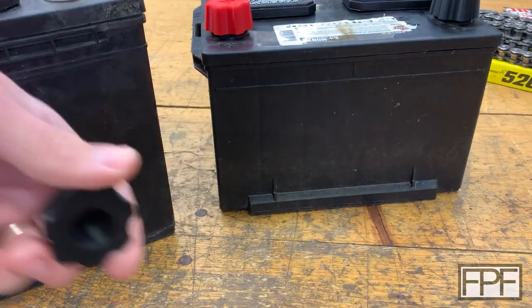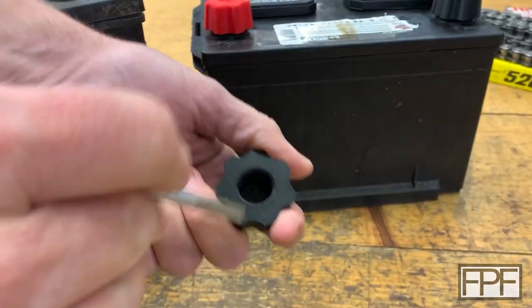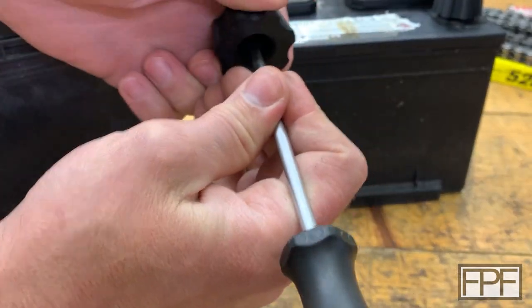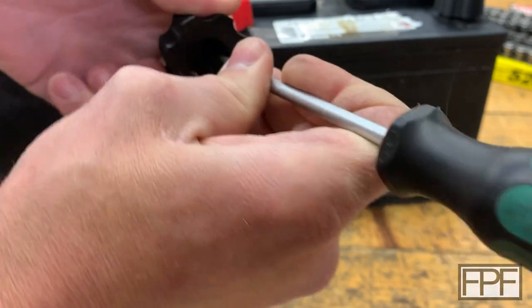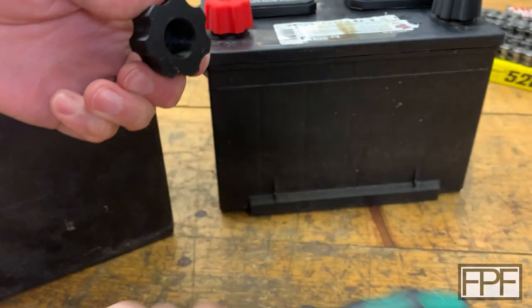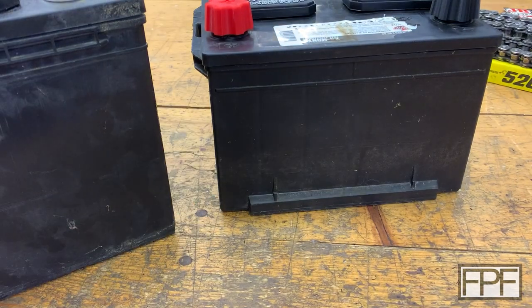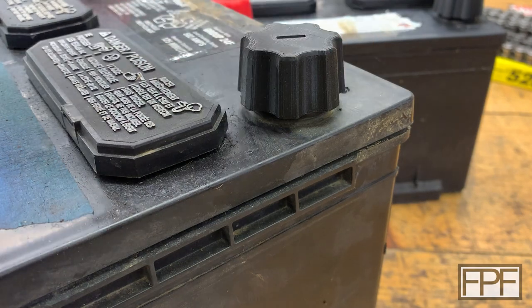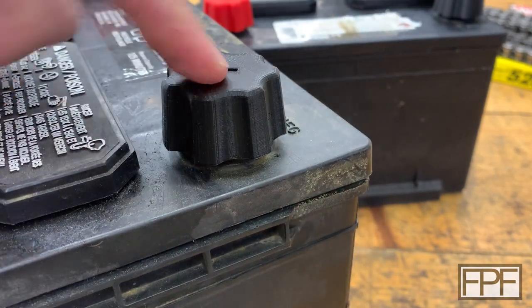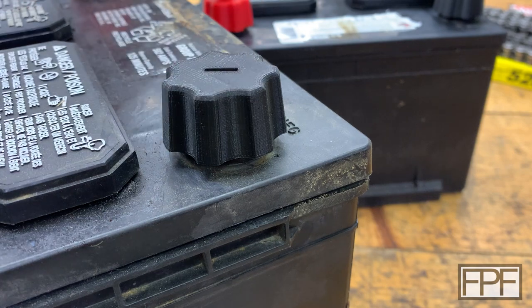Let me grab a flathead — I'll show you what I mean. You preferably want a flathead screwdriver that's a little bit sharp on the end. I'll just take it and rotate it around in there, and it just kind of breaks up all those small pieces — anything that's loose. You can see all the crap that came out of there. Let's see how this one fits. Yeah, that one fits really well. I think this one was just loose because that terminal is really smooth, but this one locks on just as good as the positive side on this battery or the positive side on the other battery.